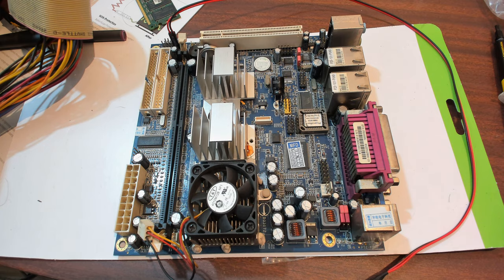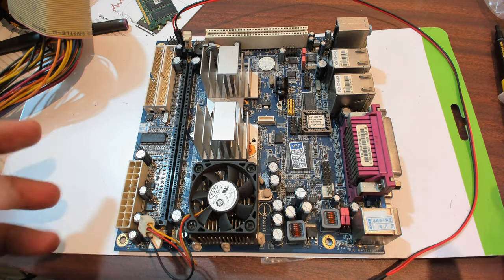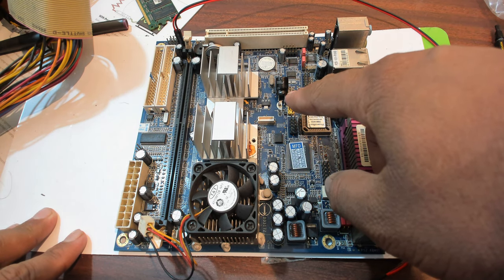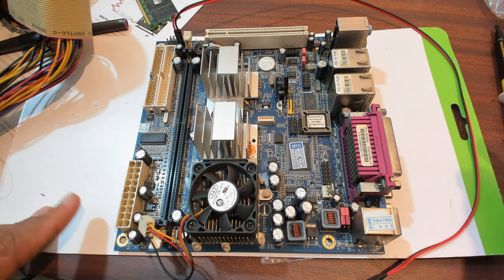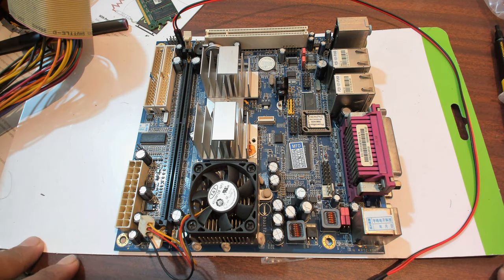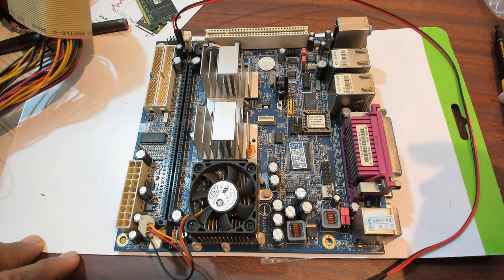Alright, welcome back everyone to another video, and in this one we are back with the Via board, and first we need to change a few things. I changed the capacitor already, so that was the one that was sort of blown-ish. So it's a botch job, couldn't do it properly. The solder on these things, since it's sort of industrial grade, is actually a bit too tough to melt. I had my iron sitting there for way longer than it should be, and it didn't budge at all.